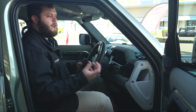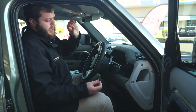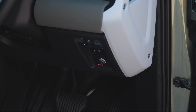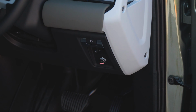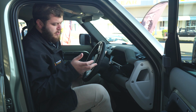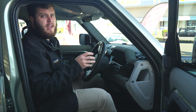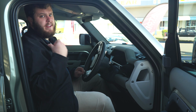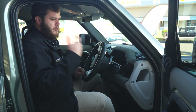They have a proportional braking mode. What that essentially means, guys, is that it has like a little inertia sensor, I guess you could call it, inside the brains of the unit. And what that does, once it's calibrated itself, is it allows for a much smoother braking experience. With a traditional brake controller, as soon as you tap the brake pedal and the device registers that the brake pedal's on, it will apply the full amount you've set it to the trailer instantaneously, which is okay. It's going to pull the trailer up, but you'll find it's quite jolty and quite a harsh braking experience.